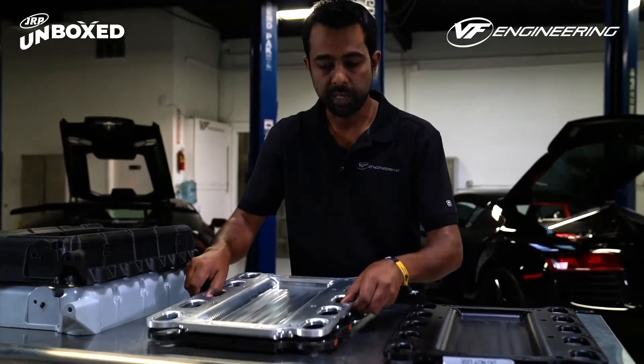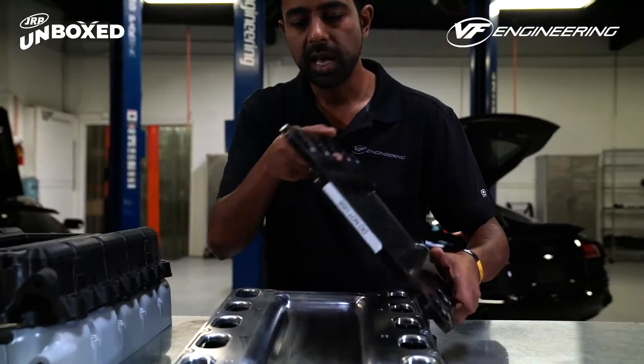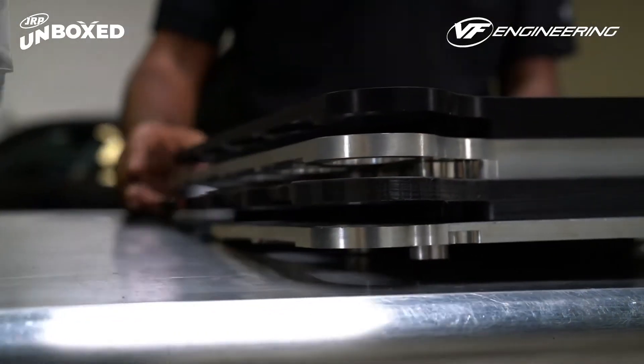The latest technology in manufacturing prototyping allowed us to test fit the actual concept and design. Once that was committed, we were able to create a pre-production piece in aluminium — it's 6061, a pretty rough cut piece — and then a finished production piece with a type 3 hard anodized finish. Additional features were added along with pocketing to lighten it up.